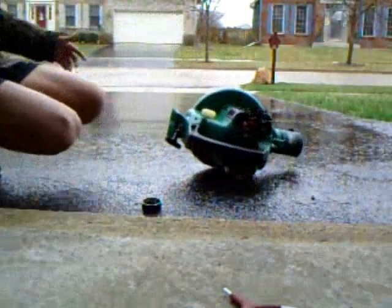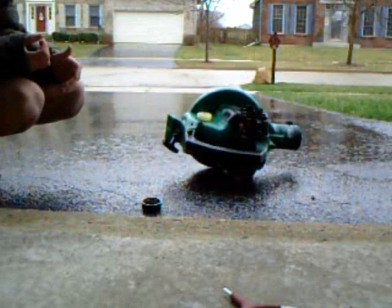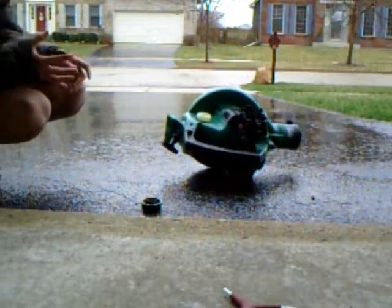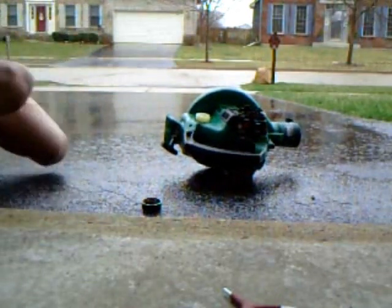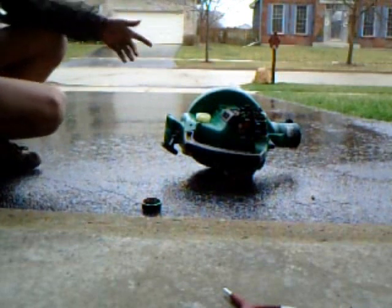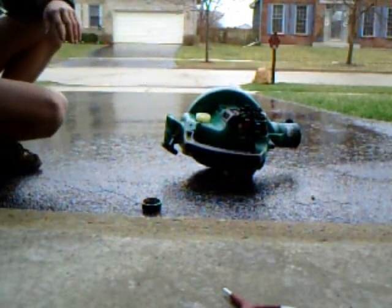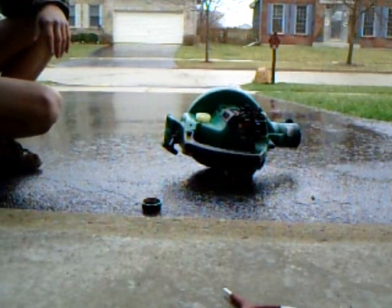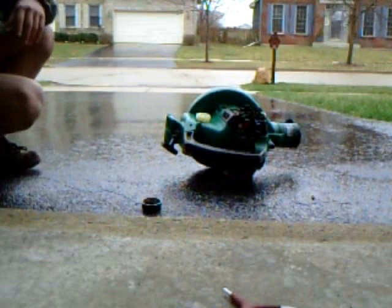If I feed her gas, she's going to run — that's not a problem. I'm not going to use a spray bottle to keep feeding her. I'm guessing it's a fuel line issue somewhere. I'm probably going to have to replace all the fuel lines, which isn't that much, but it is a big deal because I've got to take all the plastic covering off just to replace the fuel line. It's going to be a big pain. I'll update you guys as I go.